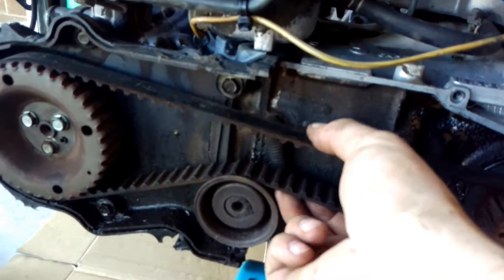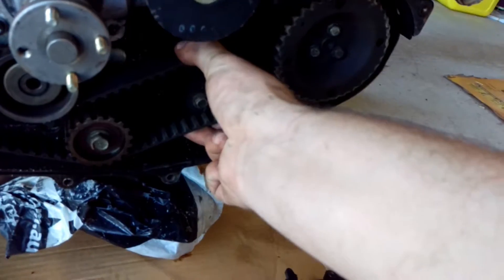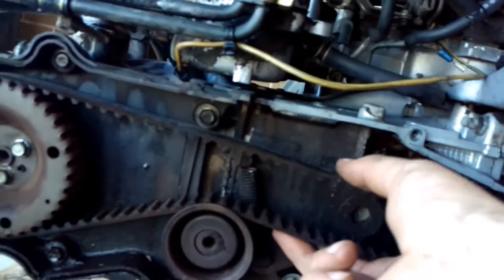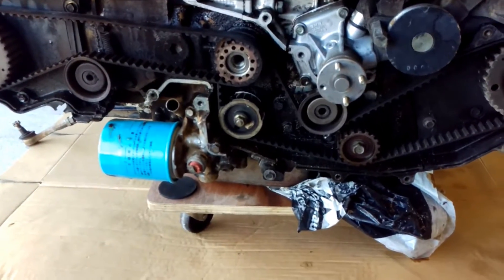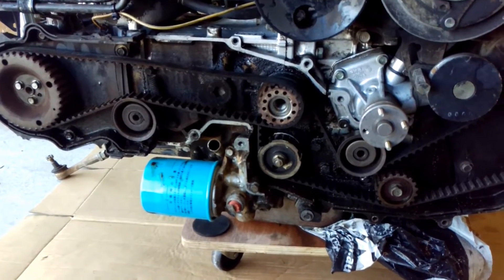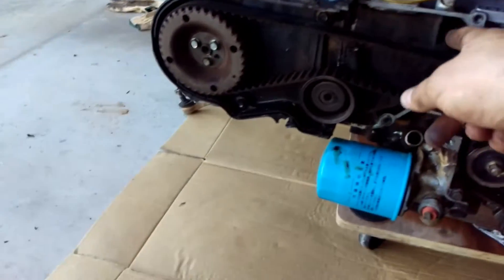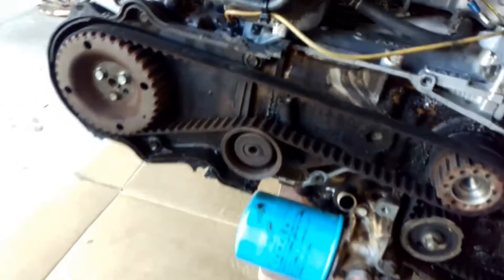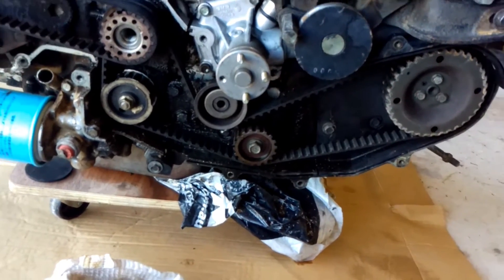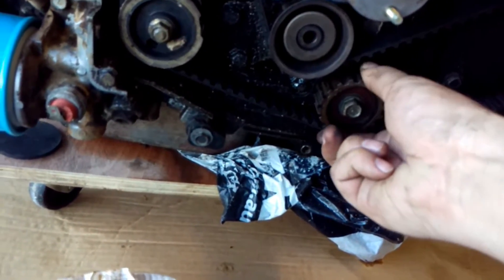It feels reasonably loose. This one is way looser — would want that tighter. At this stage what I'd be inclined to do if I was going to do anything would be to take these belts off — this one would probably nearly slide off anyway if I got in there with a screwdriver. Clean all this stuff off; it's not too gunky, a bit of degreaser and a pressure cleaner would get that off nicely. Then check all these things — the idler pulleys and tensioners. That one feels wonky already.